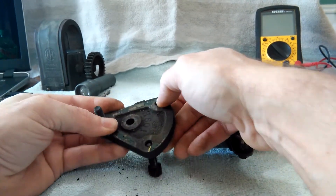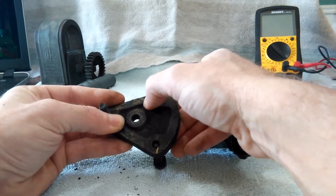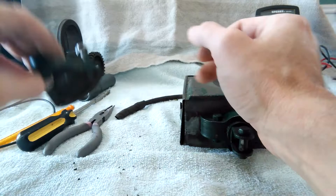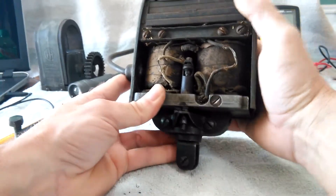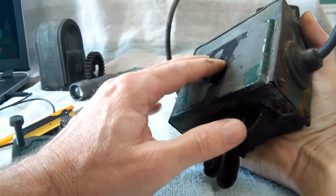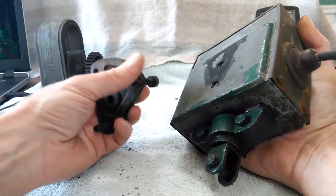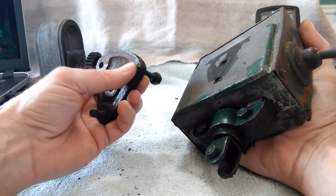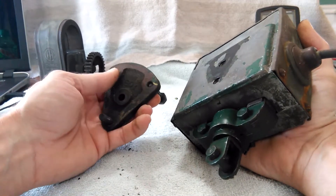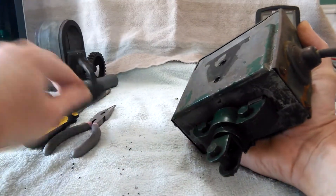It's also on the backside of this bracket — there's like glue or something here. You can't do that because this has to be grounded. If you lose your ground you're going to get an intermittent spark. I've seen some where the grounding has been so bad — maybe somebody tried to paint it, got paint all over it, and lost their ground. When they ran bolts through the holes into the block, maybe the threads were dirty and it couldn't ground properly, causing an intermittent spark.